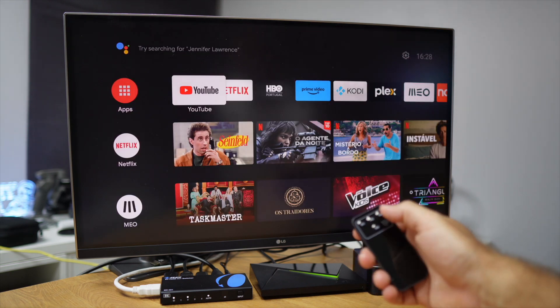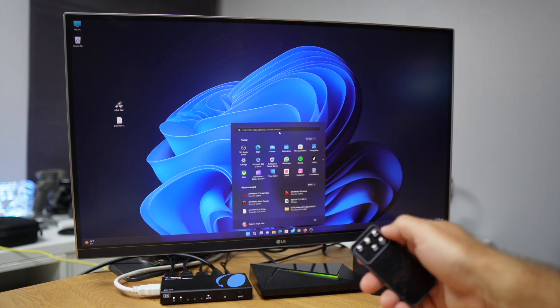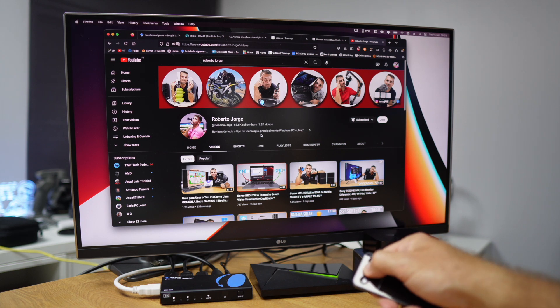We used a computer in our examples, which is probably one of the most complex devices for this setup, but we can also use a DVD player, VCR, Android TV box, Apple TV 4K — any device we want to control via USB like a keyboard, mouse, gamepad, or even an infrared remote. We can push it further: if we want multiple sources, we can connect them to an HDMI switch and then connect the HDMI switch to the HDMI extender over IP. That way we can select the DVD player, VCR, Apple TV, or computer, and whatever is connected to the switch gets fed into the extender.